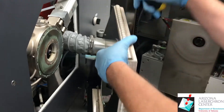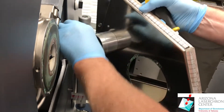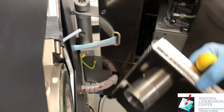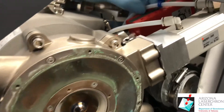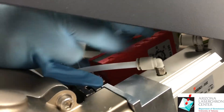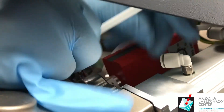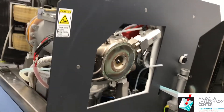They've got the exhaust hose pipe clamps — pipe clamp on it. And then this is the exhaust sensor. Remove the exhaust sensor line. The blue line is labeled on the back — they just mark it so we know that that's on the back. If they're not marked, then when you go to hook them back up, you might not remember which way they go.